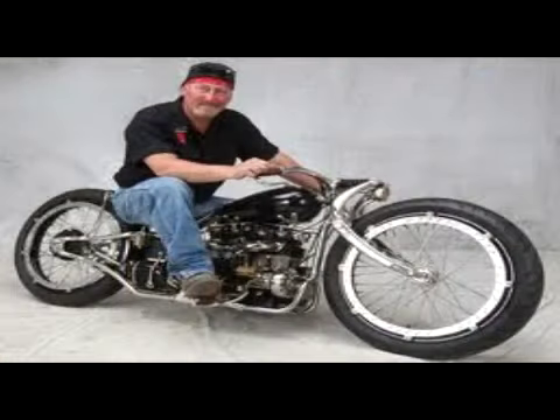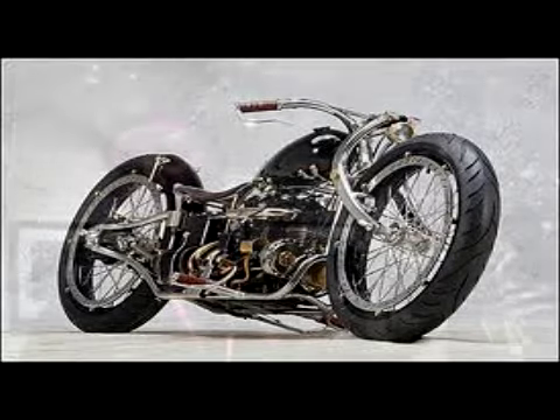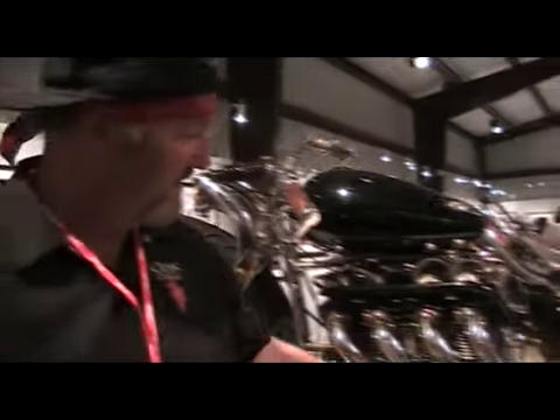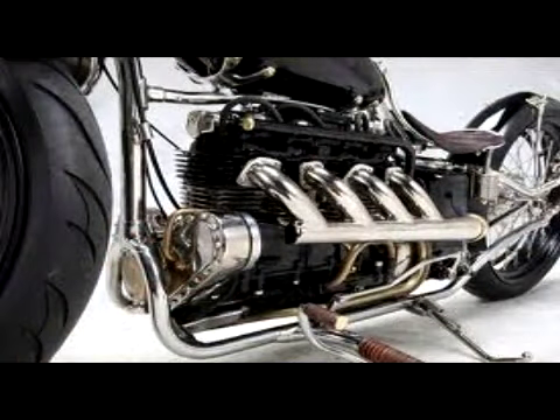So I found this — it's a Honda four-cylinder that normally sits on the bike like this. When you're sitting on the bike, the exhaust comes out the front and the carburetors are toward you. It's a '72 Honda motor. I cut the transmission off it, turned it 90 degrees, made pretty much the bottom half for an oil pan, made a bell housing for it, made a little adapter, and welded a little adapter on the back of the block.